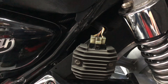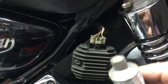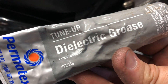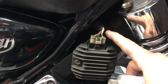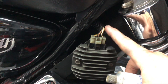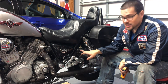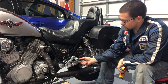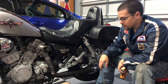One thing I forgot to mention: when attaching your electrical connectors, it's a good idea to pack them with dielectric grease. I use this Permatex number 22058 — it helps with sealing and waterproofing, and especially on motorcycles this old, it helps these connectors come out nice and smoothly. I actually left the regulator the stock color and didn't spray paint it. As you go through this on your own, make sure there is clearance for the passenger footrest to go all the way up without touching your regulator.